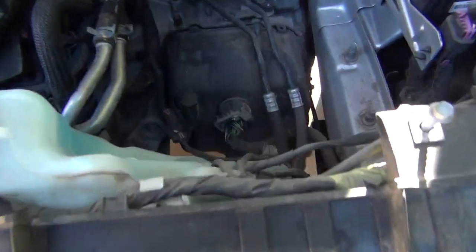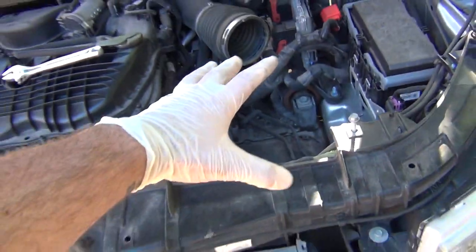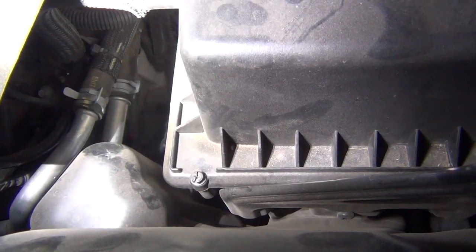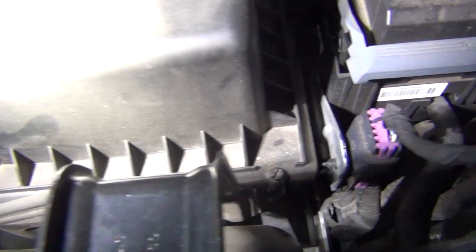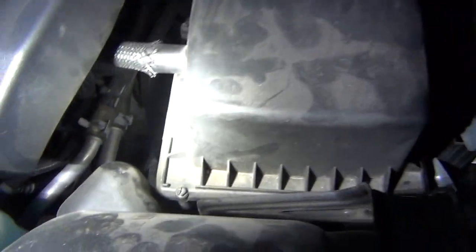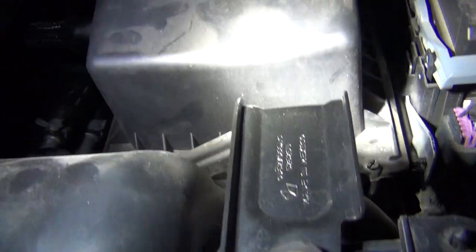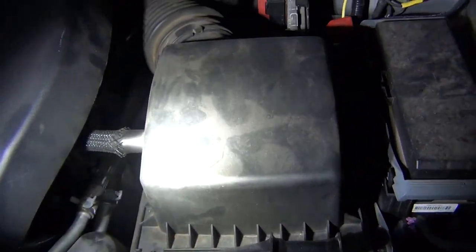Just to have more room to work and to get to the lower radiator hose, I remove the airbox sitting right there. To pull out your airbox, there's a flathead screw there, a hose to take off, and a 10mm bolt. Undo all those — there are four Phillips screws total. You can refer to my air filter video. Then the whole upper airbox piece comes out. The lower airbox piece is connected by a 10mm bolt and will just pull out by itself — no other screws required.